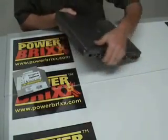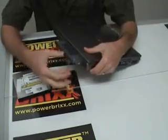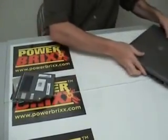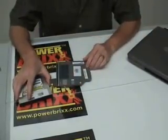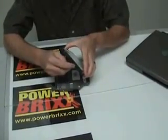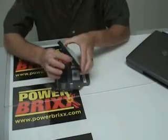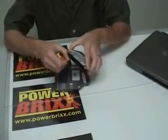Now all computers are different. The Dell Latitudes make it pretty easy to eject the drive — there is a lever that you push in and you can pull the drive out. A lot of times your particular computer will have a screw underneath that you will need to remove in order to pull the drive out. But there is a small hole in the faceplate of all optical drives that you can push the end of a paper clip into and it will eject the drive slightly.